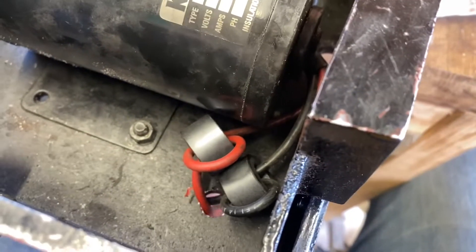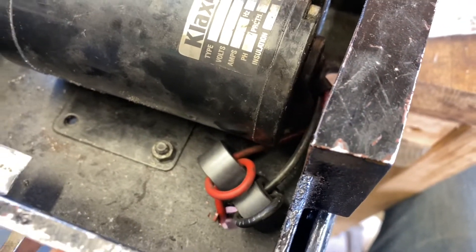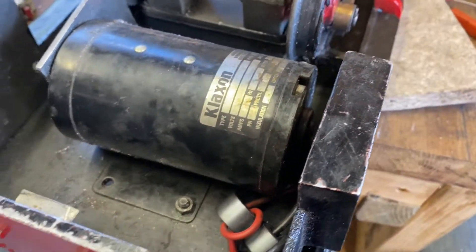To begin with I'll flip it over. The first stage of noise suppression is fitted to the wires just after the motor, before they come through to the other side to then go to the unit. So let's get them flipped over and wired on. My personal preference when putting these wires into a chocolate block is to put one of these crimped ferrules on the end. That way it's a solid bar going into the chocolate block, not clamping down on the strands which can part or come out.